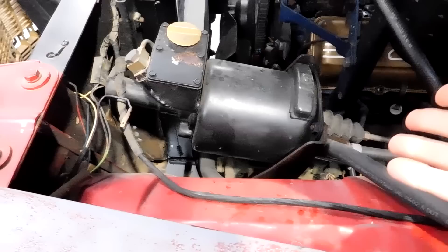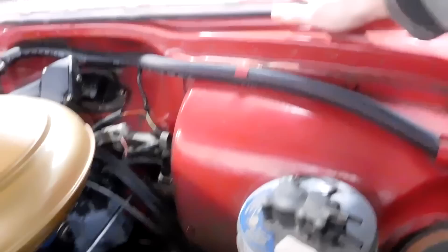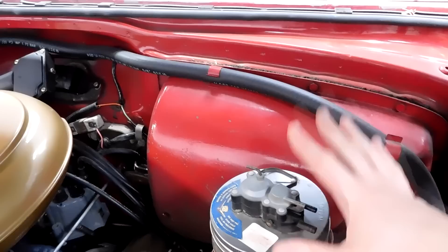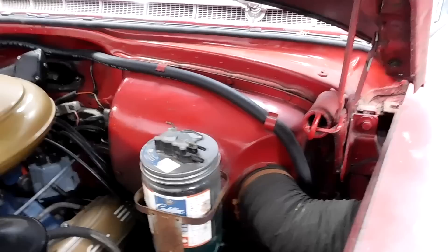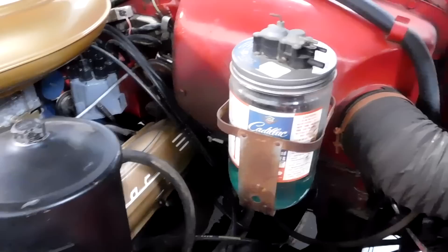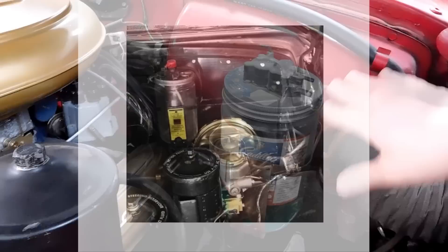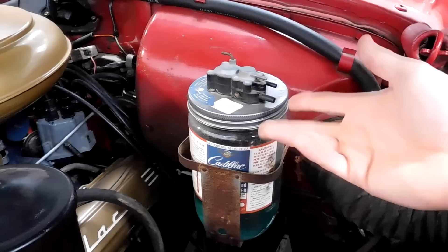The other option is to spend less money, take more time, and delete what's called the air box. Air comes in through the cowling at the windshield, goes through this air box, and there's a vent underneath the dash that blows fresh air on you — especially nice in summer since this car has no air conditioning. That box also supplies fresh air to the blower motors for the heater. You'd also lose your wiper washer, and the plate and master cylinder that stick out look ugly. You'd also have to mess with the brake pedal setup, so I'm not a fan of that option.